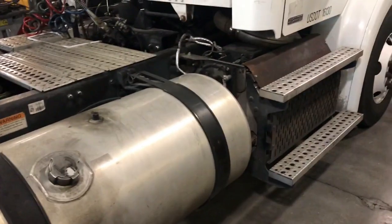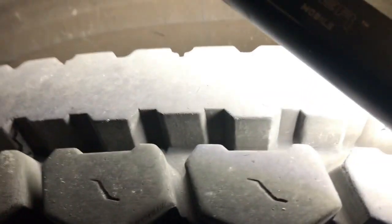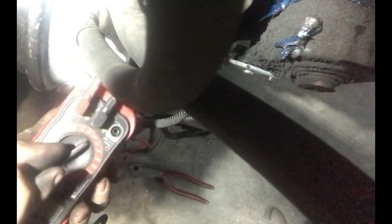Here is the right rear tire and I am going to show you the sensor in the back. I'm going to get my flashlight and look down in here. It goes inside the wheel well. So we have to disconnect it right there — it is about 4 feet long. I am going to get under the truck and we are going to take it off right here. Disconnect it from the plug. It is a 2-prong pin.